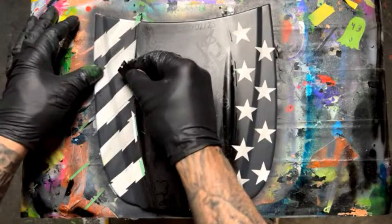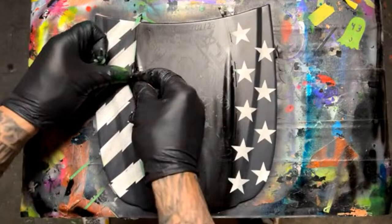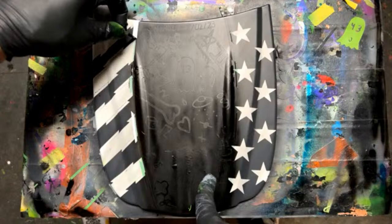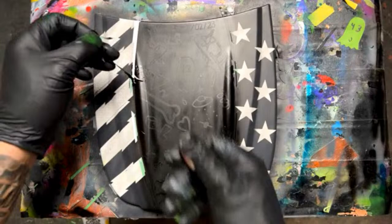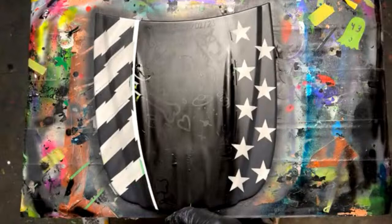I can't see what's a, oh, here we go. Looks a little rustic, right? Let's go ahead and pull these off. This is what's going to be the original white. So I was wrong. To clean those up, we would scratch back to this white, so that's not possible. We're going to have to leave that overspray. That's too bad. We'll learn that. When you butt two pieces of tape together, make sure you put a third piece of tape over the top. Huh, Ashley? Well, I knew that actually, but you know, I break the rules.